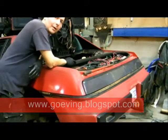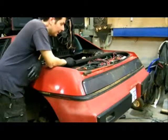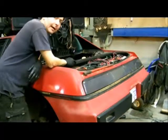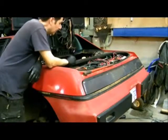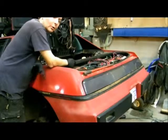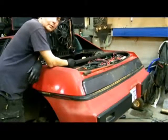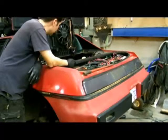It's rusted just through old age — the car is about 25 years old. So it's a good thing it happened now because this is a test pack and the new pack going in is going to be a lot heavier. So it's a good thing these lower control arm A-frame mounts are going now so I can drop everything out, reinforce them, re-weld them, and come back and sort out the problem.